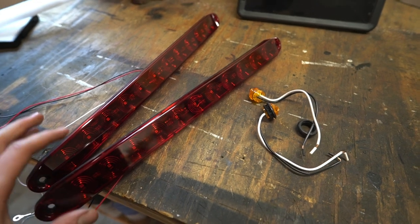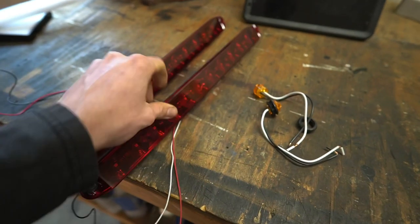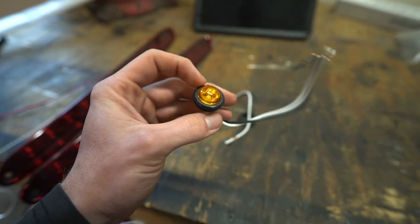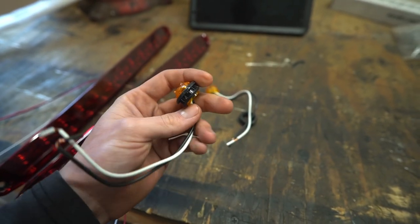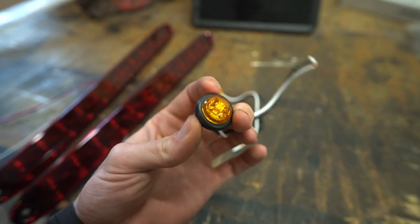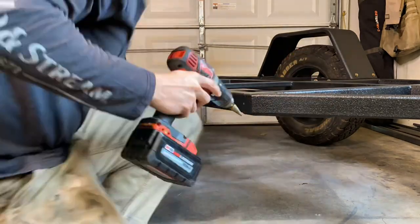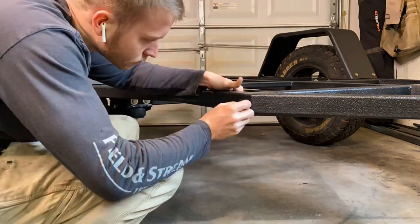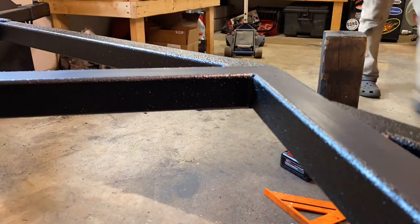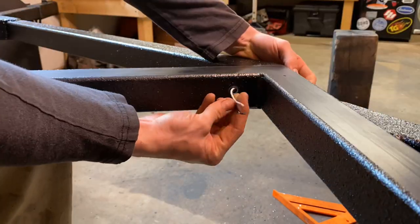Next up we're starting on wiring the trailer and getting our lights mounted. These tail lights are going to go along the back part of the frame, and these amber corners are going to go on the front of the trailer, one on each side — nice and bright, sit flush, not hanging out too much, easy not to break or get hung up on the trail. For these front marker lights, I place them on the front corners of the trailer. You'll need to drill at least a three-quarter-inch hole, and then on the inside of the frame drill a smaller hole so wires can pass through to the trailer harness.